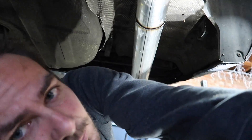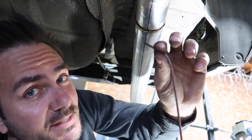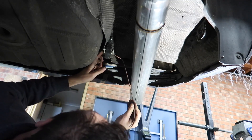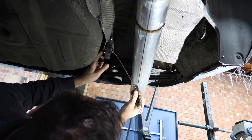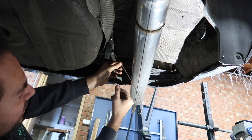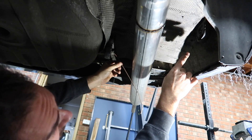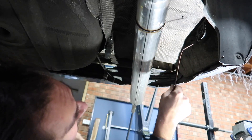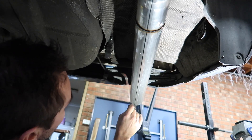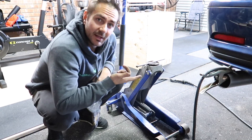To work out the angle, I just got a welding rod and used it because it's easy to bend — I can tweak it a little bit to get the right angle. I've chucked it up in the hanger, made sure it's hard up against the rubber and touching the exhaust pipe. The one up here will be a different angle so I'll need to test that separately. Alright, I'm going to heat this hanger rod up now and bend it into shape and give it a test fit.